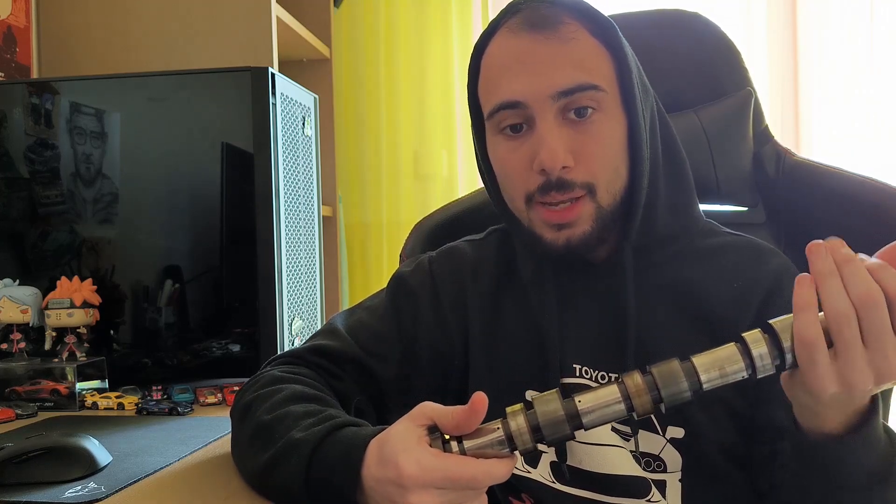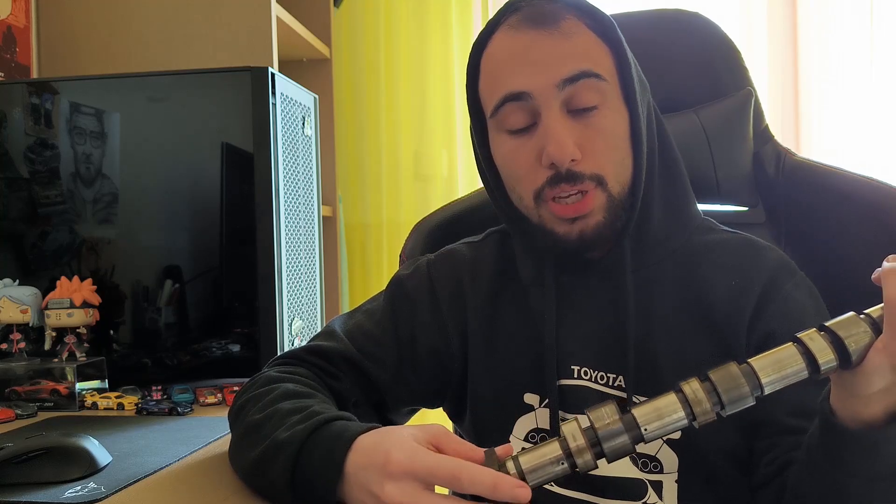Let's get to the rocker arms — a part many people don't know about. They think the camshaft gets damaged by bad oiling and thin oil alone, but high revs and overheating the oil are also a very big concern. If you overheat the oil, you lose viscosity — if you use 10W40 and go over the oil's operating temp, you suddenly make it effectively 10W33 or lower, dropping viscosity. Eventually you have a water-like substance not protecting anything — not just your cams, but bearings and every single component that needs lubrication.